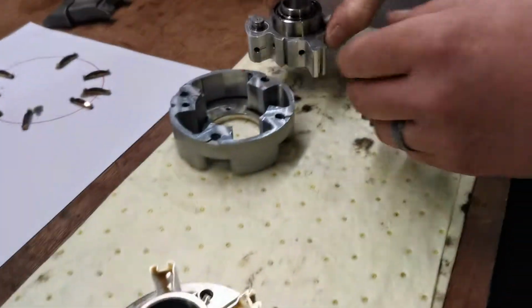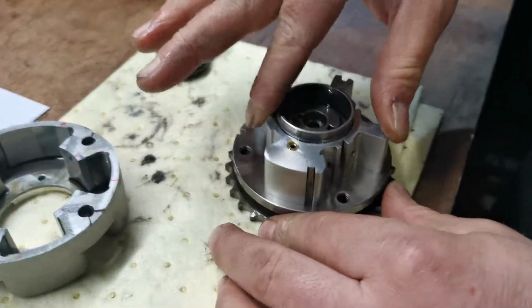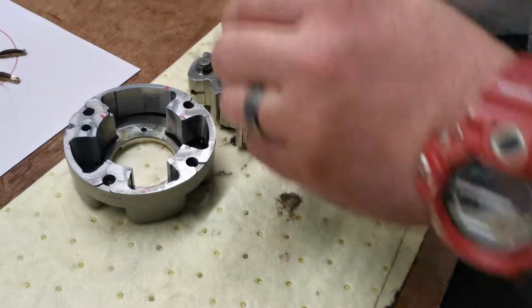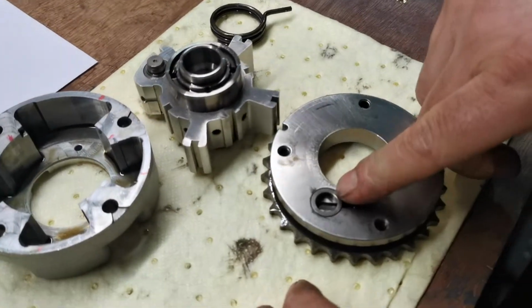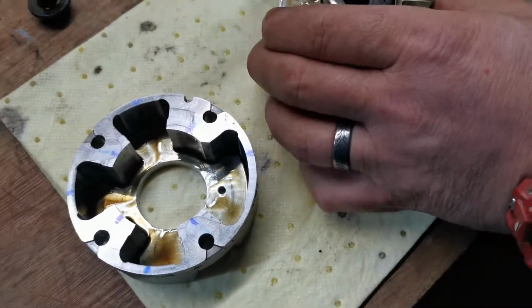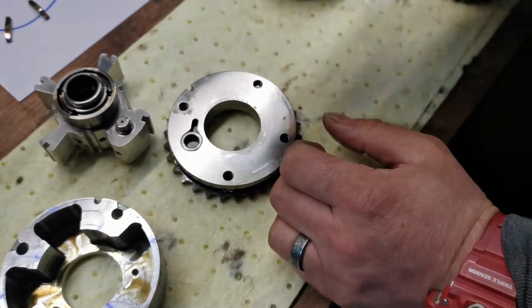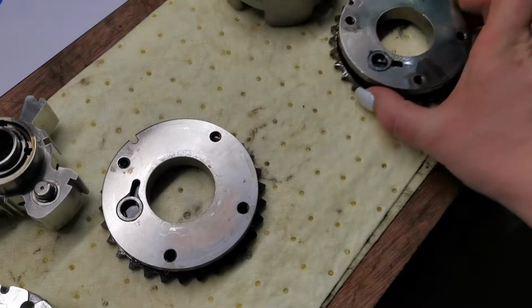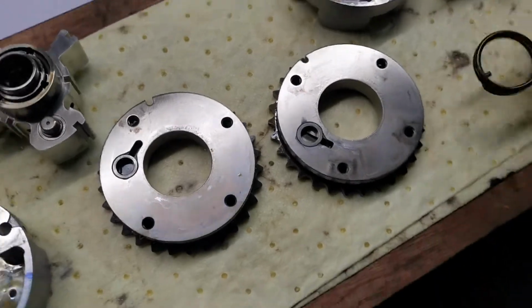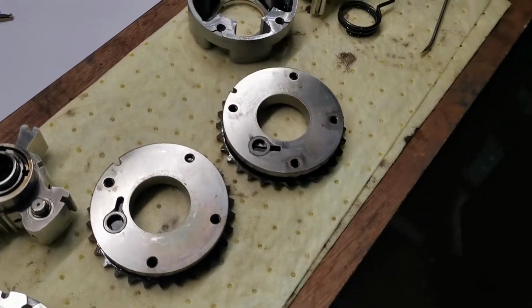Now we've got the exhaust side here, and if we do the same again, I think that is what's causing it. But I'm not entirely sure, it's just a guess. I have measured that. It was about 9.8 millimeters in ID, and this one over here was slightly smaller. So that's bigger for a reason. It has to be, but I think that's where the cold start rattles are coming from. And you have a spring as well, which assists this. It always keeps it in a closed position, if you want to call it that.